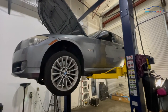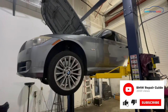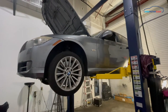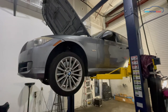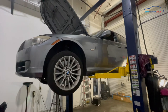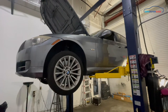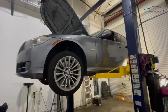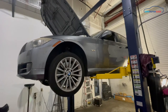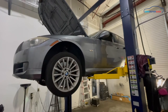To see exactly which fault codes are relevant to the E90, we suggest you go to our article at BMW Repair Guide where we have them listed. The fuel leak detection pump and the charcoal canister on the E90 are located behind the left rear bumper. They are very easy to access, but we do suggest that you jack up the rear of the car to get to them. This repair can be done with the car on the ground but it's extremely difficult and you're opening yourself up to breaking something, so it's best if the rear of the car is jacked up off the ground.